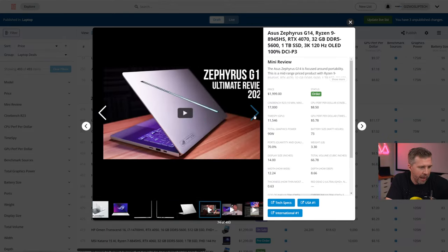Let's take a look at temps and power limit draws. So our temps with the Ryzen spiked. It did reach 95 degrees at one point. With the Intel, we did surpass 99. We went all the way to 101 at our peak max temps. Currently at 100 degrees for our peak temp on the Intel. 92 on the Ryzen, almost to the thermal throttle. Pretty sure 95 degrees is the thermal throttle range for the Ryzen chip versus 100 for the Intel Ultra 9. So both of them are bouncing into their thermal throttle limits. So this means that a laptop cooler could theoretically slightly boost our CPU performance. Let's run them again. Very similar scores again for our third run.